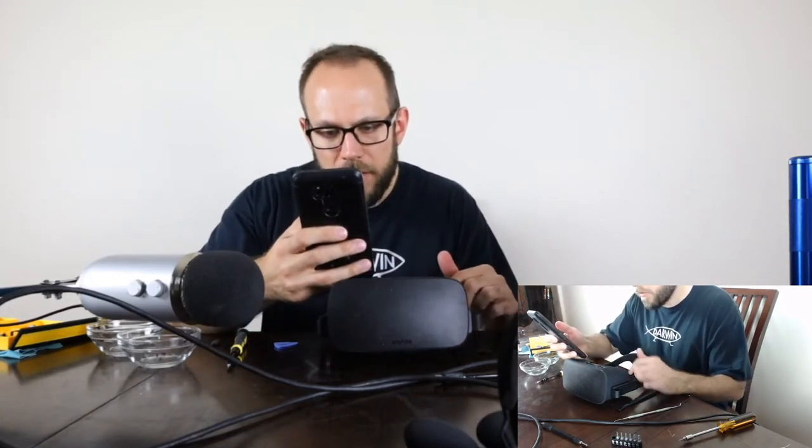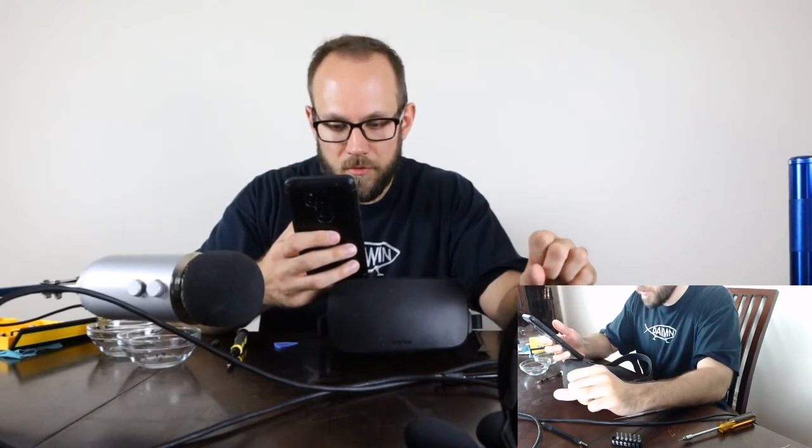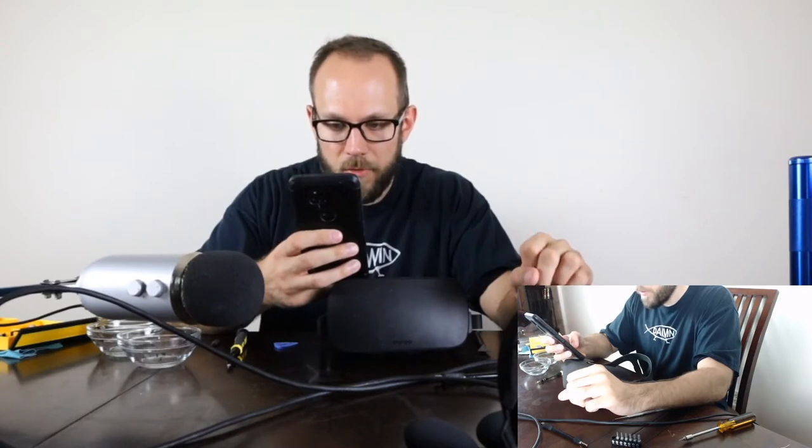Stretchy black lycra surrounds the lenses, covering a thin plastic frame. This dustproof fabric cleverly protects the Oculus's innards, while still allowing the adjustable lenses some freedom to move. Frame contains blah blah blah. How do you remove it? We're momentarily stumped until our teardown engineer finds the hidden interior clips to secure the frame. After a few well-placed flicks of the spudger, it's free.